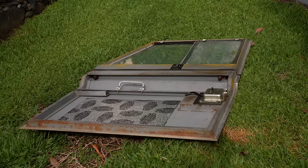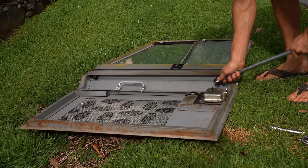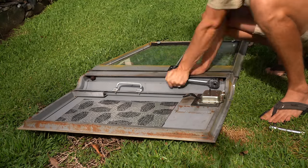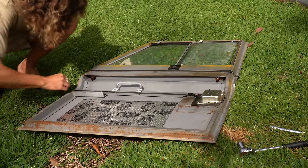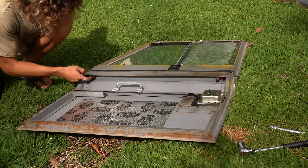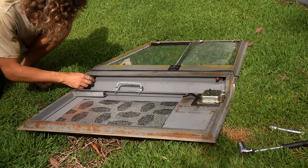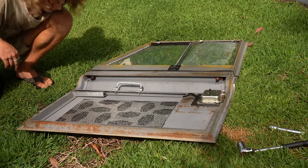I've had to call in a longer bar for this one so I can get a little bit more torque on it. Yeah, it's hot. I think for this one it's so bad that I might actually just grind the end off, and then hopefully the thread that the nut's on isn't completely screwed. If I just grind the end off, it doesn't have to travel as far to come off and doesn't have to work through all that extra gunk — because that is completely rotted. I'll just nip that off to make my life easier.